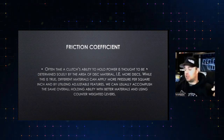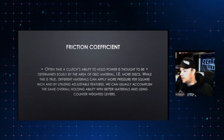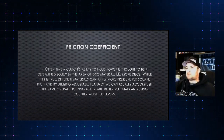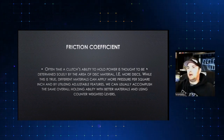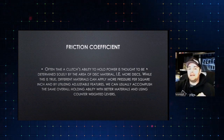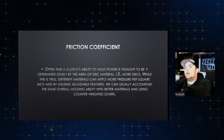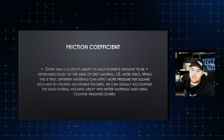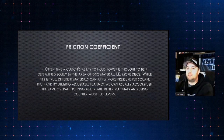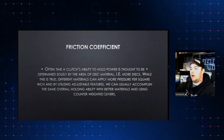To bring it up, this is actually good timing. We had a question just come in from Bill Armstrong. He's asking basically how does the floater plate on a twin disc handle the heat? That is a question that can be answered in multiple ways, and what I mean by that is it depends on what kind of clutch we're having in it, what the floater is. Is the floater bare steel? Is it a bronze ceramic type, or is it something coated? Knowing Bill well enough, I'm going to take a shot here and say that Bill's probably talking both about the diaphragm stuff that he's used to, as well as the long style.